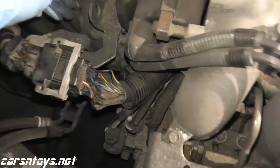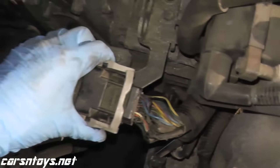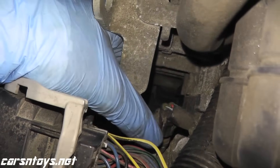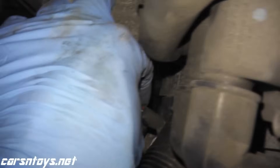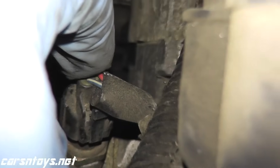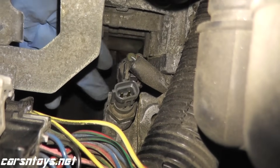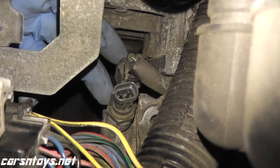The sensor lives right here on this vehicle, so we just need to remove the harness connector. This engine harness connection, I think, will be okay — we don't have to remove it. Right here where my thumb is, it's very, very tight, but let me just squeeze it. There's a tab right there, so squeeze it in. And there you go. As you can see, this is held on by an 18-millimeter nut — it's an entire unit on the sensor.